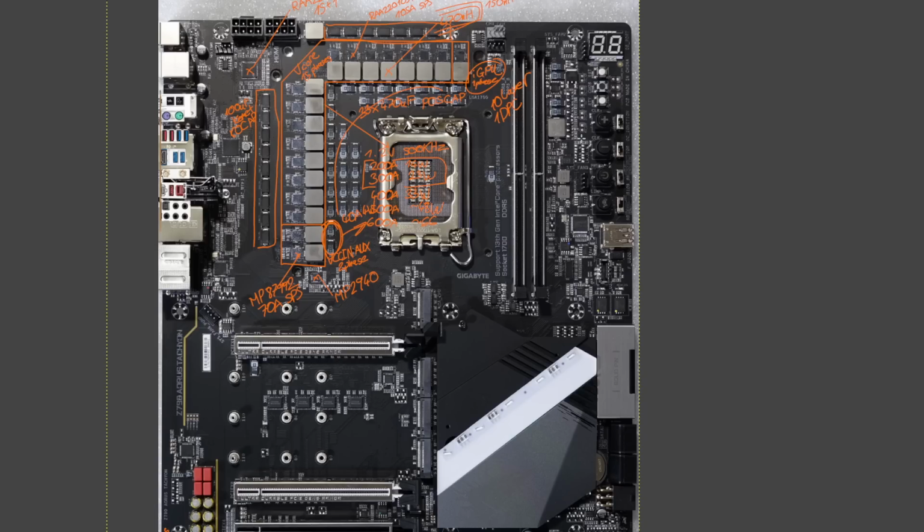But compared to other extreme overclocking boards, like the Dark for benching, the Dark, I'd say, is a bit better. And then for 24/7 stability, it doesn't do DDR5-8000 unless you ignore good stress testing practices. If you run one stress test for 2 hours, you can do DDR5-8000. Sure. If you actually run a full battery of stress tests, it's going to fail at least one of them every single time, which is infuriating. But that's also been my experience on so many other motherboards at far lower memory speeds.